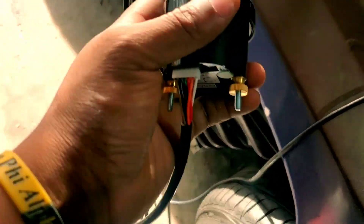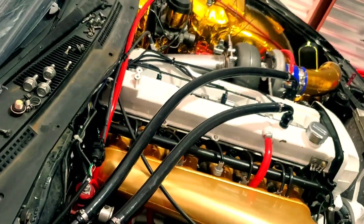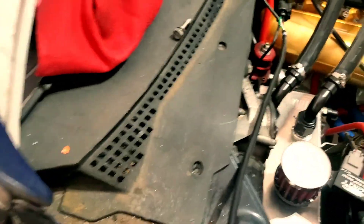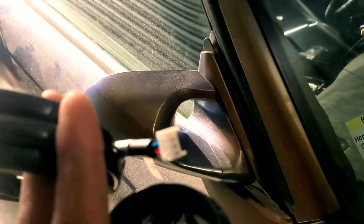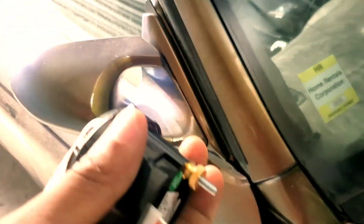This is what you will have to hardwire in. So you're gonna figure out where your gauge is gonna mount. Route this harness accordingly. Mine is gonna be routed through the firewall kind of where the ECU stuff is, and then back over to the driver's side to where my gauge holder is gonna be, and then I'm gonna plug this in and figure that out.